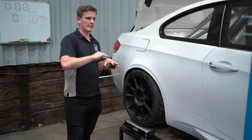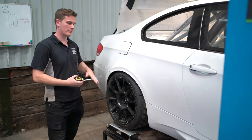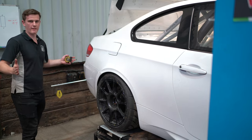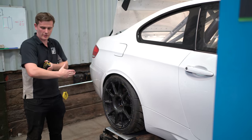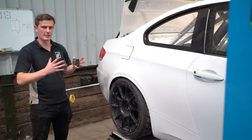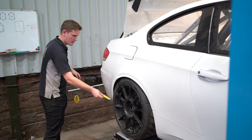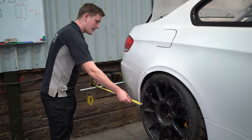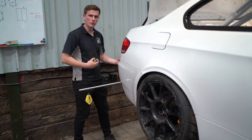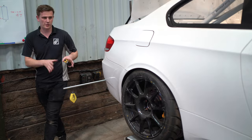With the string height set to 31 centimeters from the floor all the way around the car, the string is now running exactly through the center line of each wheel. The next step is to take a measurement from the rear edge of the rim to the bar to get the swing of the bar correct — we want that bar exactly perpendicular to the center line of the chassis. We often start with the rear wheels because in most cases the rear isn't full of adjustable arms, so we can trust those wheels are square with the chassis. Measuring from the back edge of the rim to the center line of the pole — 82 centimeters here — we ensure that measurement is the same across the rear, adjusting by shimming the pole in the hook at the rear of the kit.